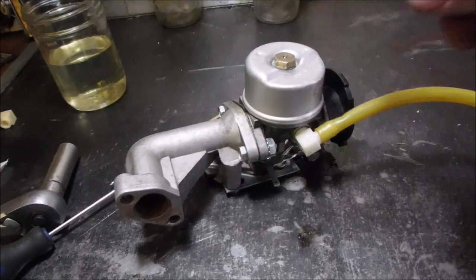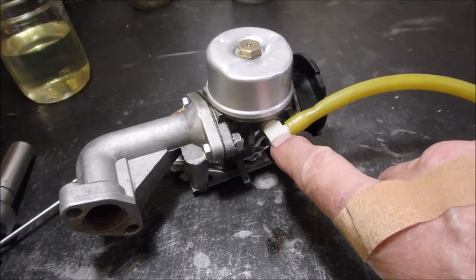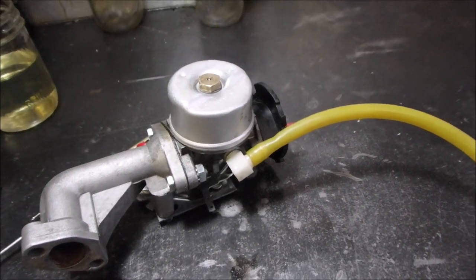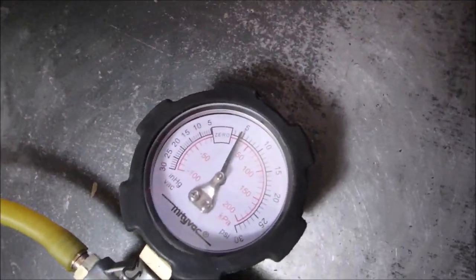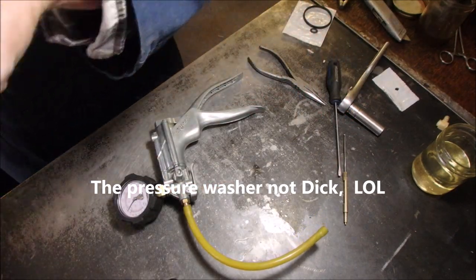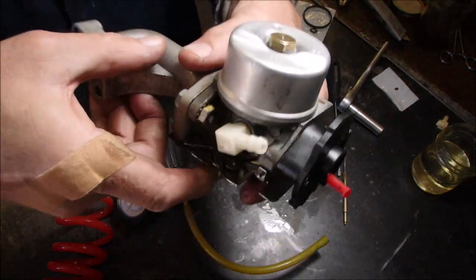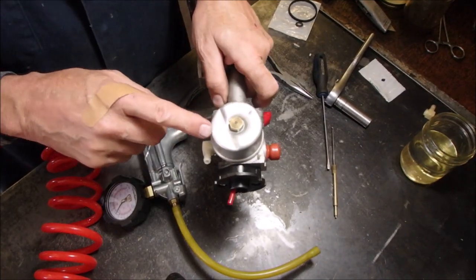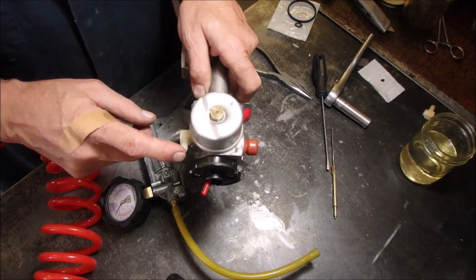So there's the carburetor with the bowl back on, the brand new inlet that I got off a carburetor that Mick sent me. It's pressed on nice with my big C-clamp, and it's holding five pounds in a static state — just laying there. I want to get a picture of this for my buddy Dick. I've had a fair bit of trouble with this. So I'm going to take a picture of the new inlet.